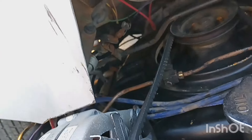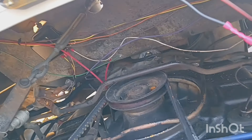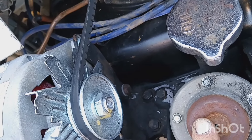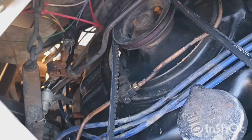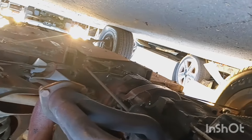The fuel lines are dangerous — you can see right here where the belt is actually rubbing on the fuel line, which is not good. It does have an electric fuel pump up front, basically the same setup I just did, except it bypasses the manual fuel pump. If I were to work on this car, sorting out this dangerous fuel line situation would be the first requirement — putting the blank in and getting it set up correctly. One major positive difference: this has a Corvair transaxle, as opposed to the green one which has a VW transaxle, so this has Corvair suspension underneath.